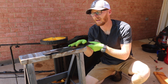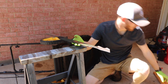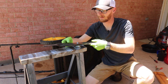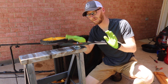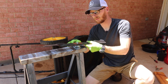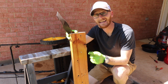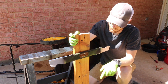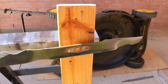It's super important that you take the same amount of material off both sides — your blade needs to be balanced. You can get a specialty blade balancing tool off Amazon for a few bucks. Set it in the middle and whichever side is lower is the heavier side. If it's unbalanced and spinning on the bottom of your mower, it's going to start wobbling and shaking, and that's super unsafe. Alternatively, stick a nail into a board on a vertical surface and hang your mower blade from it — if one side is heavier, it'll tip and tell you which side needs more material removed.